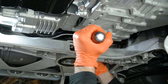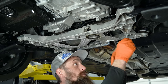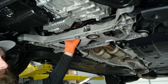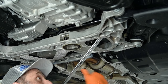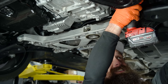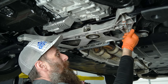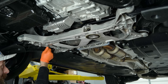If you're careful, you can take a pry bar through the opening and just bump it the rest of the way down. It should sit pretty much flush at the top. Next, we've got to get our sway bar mounted back up — it probably moved a bit, so you might need to either grab a pry bar and massage it back into place, or take the end links off and that'll free the whole thing up quite a bit, depending on how far it moved. After messing around with the sway bar for a few minutes, I decided to just take the end links off. Now the bar has no tension on it at all — much easier to get the bolt lined up. See how easy that was?